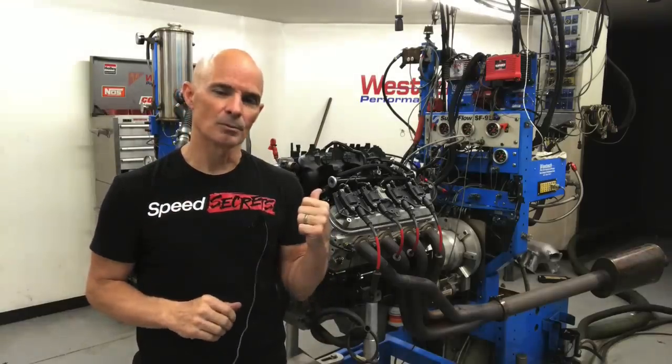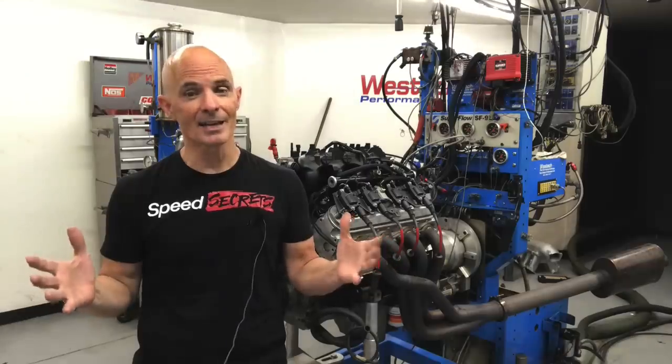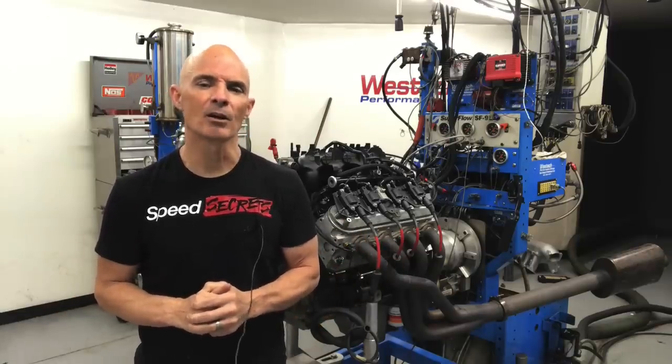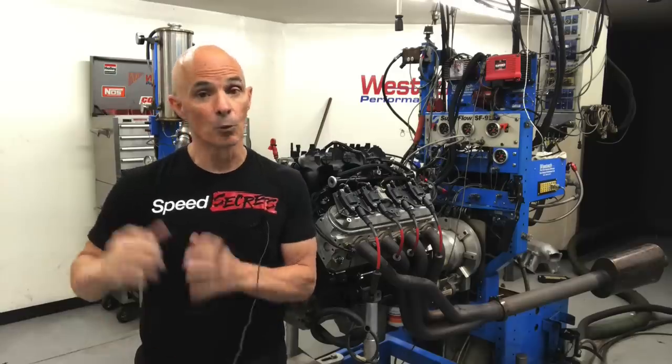Here's my opinion. I think it's because of our test mode. I think these cams are good sized cams for a 4.8 liter. In fact, and I tell this a lot, that Sloppy Stage 2 with 228 degrees of intake duration, I think it's too big for a 4.8 liter, especially for any kind of street car. Now sure, if you're running it to 7,500 RPM or 8,000 RPM, it works well, especially under boost. You can make a ton of power if you want to run at that engine speed.